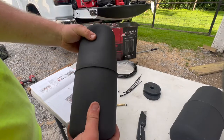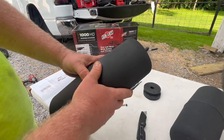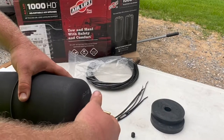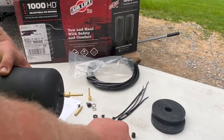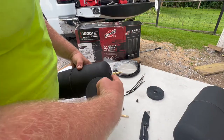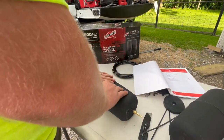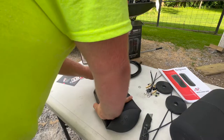The directions say to take the spring out to install, but I don't think that's necessary. What you can do is fold the bag up like a hot dog, zip tie it tight, then feed it in between two of the springs. On top of the air spring, screw the stem on tight, then the hose goes over the nipple with a hose clamp to hold it. The isolator protects the bottom part. Now we compress it down and zip tie it like a hot dog - don't squish all the air out though.